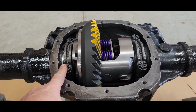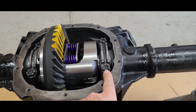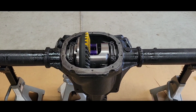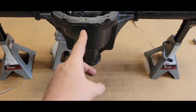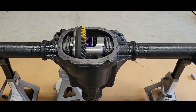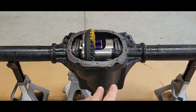I mean, I technically could just go ahead and take 25 off of the stock shim on this side, and then just use a 25 over here. I could do that too. So we'll see. Anyways, gonna finish that up tonight and put it all back together tomorrow. Get my setup bearings out of the pinion, put the good bearings in here, the crush collar, torque it down, get my inch-pounds of resistance on the pinion, put everything back together, and I'll double check backlash, double check pattern again, because you never know.